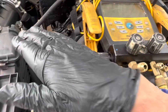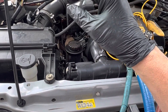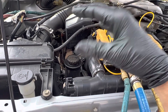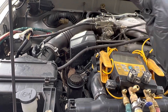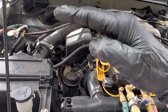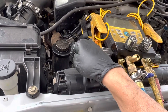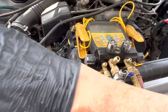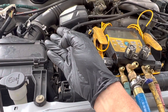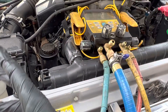That's normal operation because there's enough liquid refrigerant in the system to expand and achieve a pressure over the minimum set point for the safety cut-in. Once the safety contacts cut in to give the electrical signal to the compressor and it kicks on, that's the last time it looks at the low pressure switch — because it's on the high side. That was enough, and it just keeps on running until it burns out the compressor.